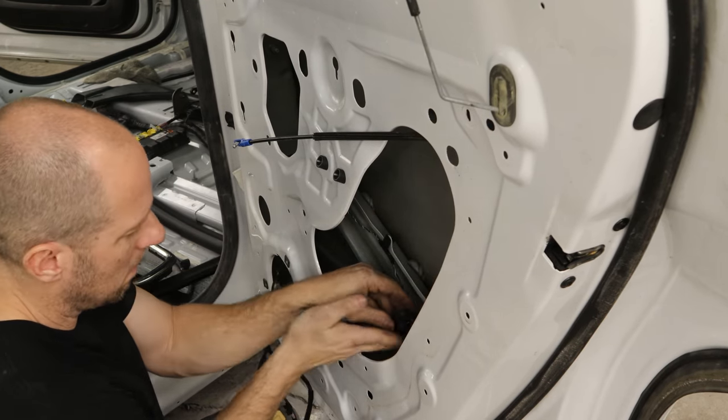Now it's arts and crafts time. We're going to glue our original wiring harness and antenna wires to our new headliner — we just tore the old ones off. Just a little hot glue gun to stick them back on here. We did have to cut a hole for one extra speaker in the front — we made a template out of the other one and cut the hole out, snapped the speaker in and it was done. Now we'll throw some cavity wax up in that top roof rail before we put the headliner back in, while we're waiting for our glue to harden up.